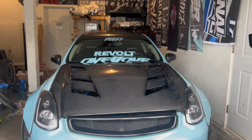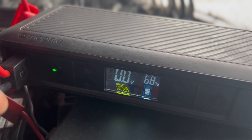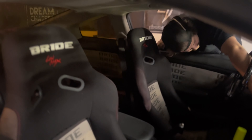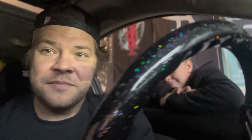We'll get this pig started — she's dead. Unfortunately we let it sit too long. This booster won't pick up the battery from zero volts, so I'm gonna get some cables, pull the truck up and jump it that way. We're going back to the booster box — hopefully there's enough of a charge now to pick it up. It doesn't usually want to boost unless it's got at least one to two volts in the battery, and there was zero as you guys saw.